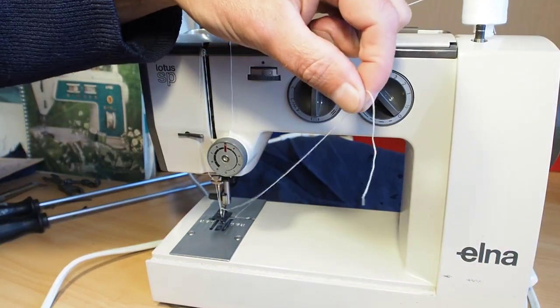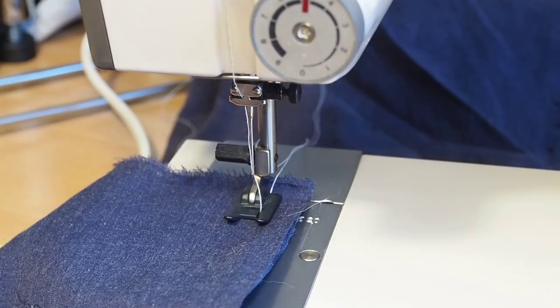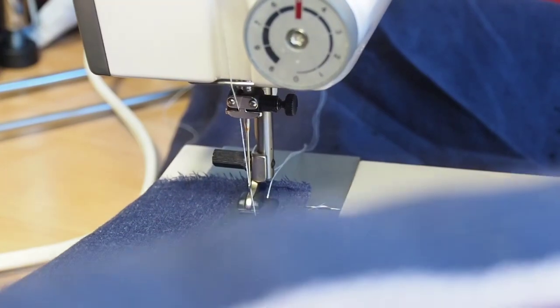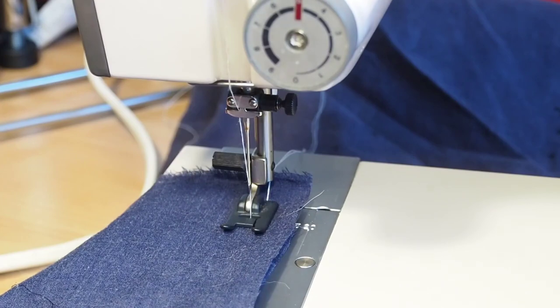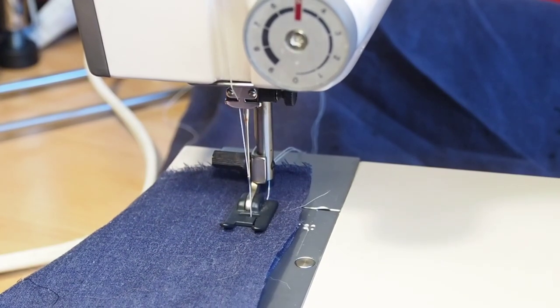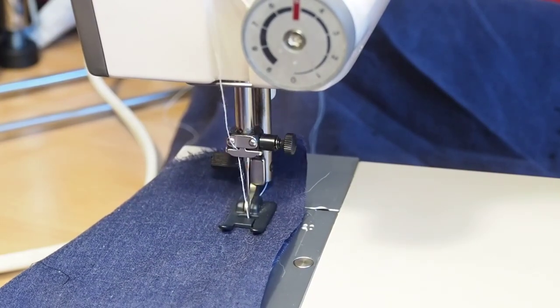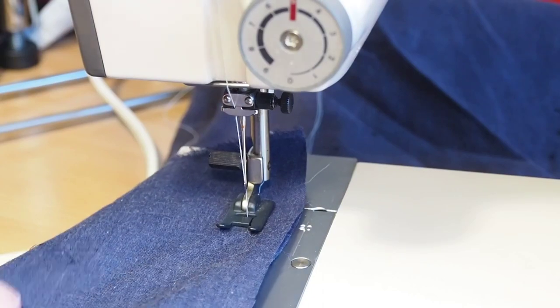Okay, picking up bobbin thread, that's a good start. And it wasn't a fluke that time. Just tentatively start here. I'll start by turning by hand. I would always do that after a major job like this. So we're on the longest stitch length. Everything seems in order, nothing's jamming. Feed timing is fine. Let's go.